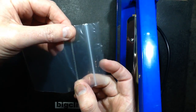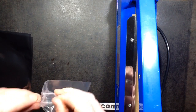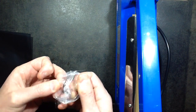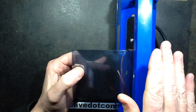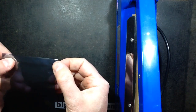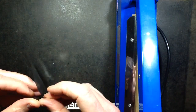You can actually see the line it makes across the plastic, and generally the plastic will tear at that point before the seal bursts apart. Another useful one is these anti-static packets — it seems to have no problem sealing those as well. You can see it creates almost a clear line, almost like a transparent line through the metallization because it's joined the two sides, and it produces a very tight seal.